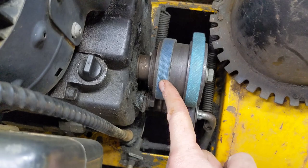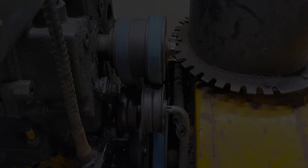The drive belt turned out to be a half by 30 inch belt. I tried a half by 29 and it was too tight, and a half by 31 was slipping when engaged, so a half by 30 is perfect.